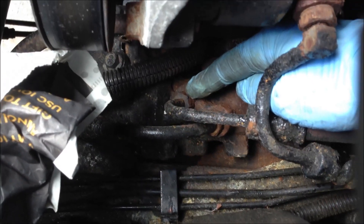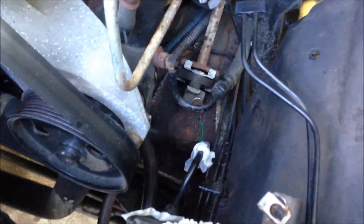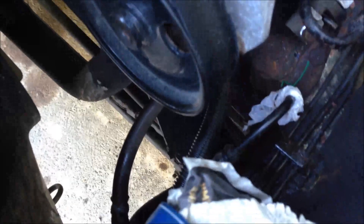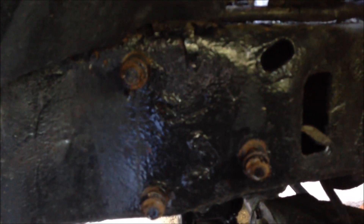The lines look a little rusted — I'm hoping they don't give me too much trouble, but who knows. Got it all out. Here you can see the bolt right down there — that little bolt head is the only thing holding the steering column to the steering gear connection. Take that off, slide it this way, and it comes right out. Of course, you've got the arm that connects up to the pitman arm — that disconnected not too bad. And there are also three bolts right here, and they came out rather easily, so that wasn't too bad either.